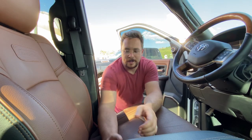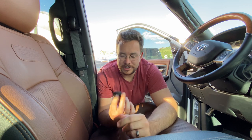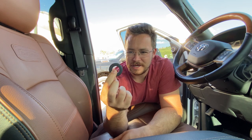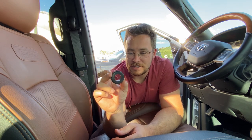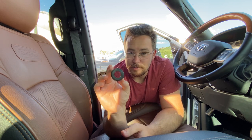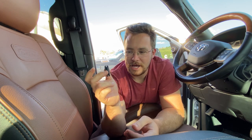Sorry, I'm hopping along — my foot still hurts. I'll probably pull out the mat so I can show you under there. I originally wanted the shop to do everything including the wiring, but they couldn't figure out how to put in the sensors. What they were using were these rubber grommets, which aren't really made for that. These rubber grommets are for if you don't have sensors and want to run wires to, say, a light bar or horn — you put them around the hole so you can feed wires through without them getting damaged.